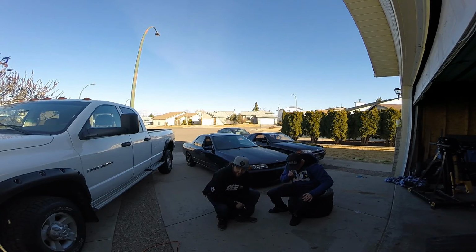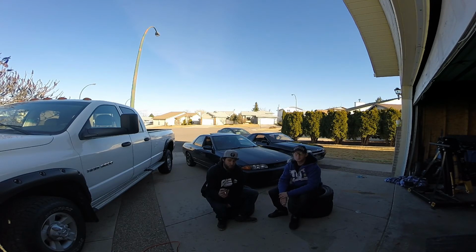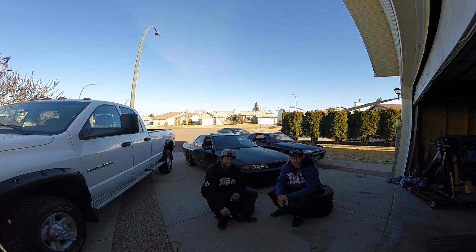What's up, guys? So this is our second webisode. Today we will be working on Craig's Skyline that is directly behind me, the four-door one, obviously. So do you want to explain to them what we're doing today in your car? Okay, so basically, the turbo sounds messed up. It sounds like there's some sort of scraping on the walls of the housing, so the blades will be touching the sides, and we don't want that to get damaged anymore, so we're gonna swap it out.